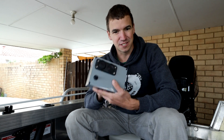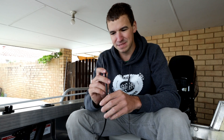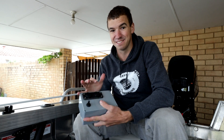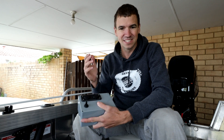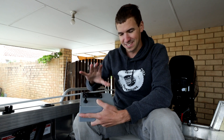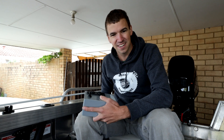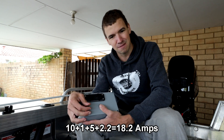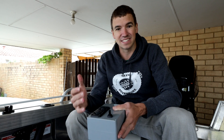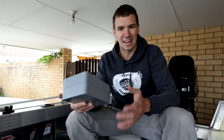First things first, we need to get some power to the junction box. For that we're going to use some twin core cable rated to 30 amps. How did I decide on the cable? I went through and calculated how much everything would draw if it was all on at the same time. Your standard 12 volt accessory socket is usually rated for 10 amps, the USBs draw about one amp, the 12 volt marine radio takes five amps, and the bilge pump takes 2.2 amps. How do you know how much things draw? Generally the manufacturer will tell you in the specifications. If you can't find it, you've got to get an amp meter and test it yourself.